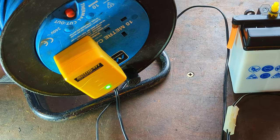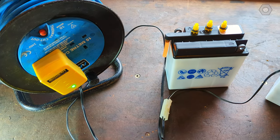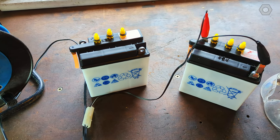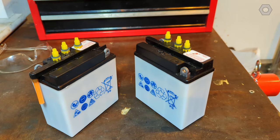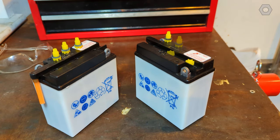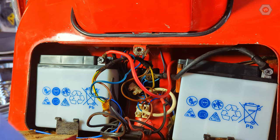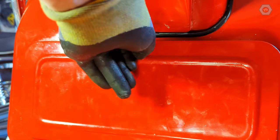After charging these new batteries, I let them sit for several hours, as the process releases hydrogen, which we know is an explosive gas. So no welding or grinding today. The electrical system on the Prima is unusual. These are two 6V batteries wired in series to create a 12V circuit. The reason behind this is the Prima has a Dynastart, or starter generator, instead of a kickstart, so the bike could be started by a person wearing high heels, which I am not willing to demonstrate for you.